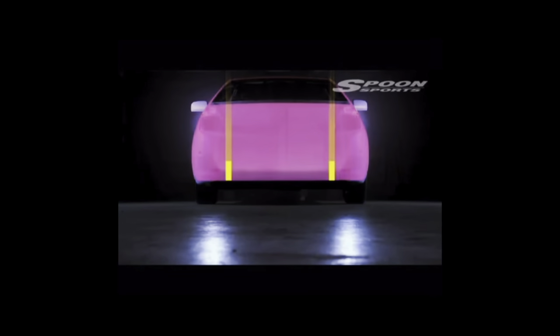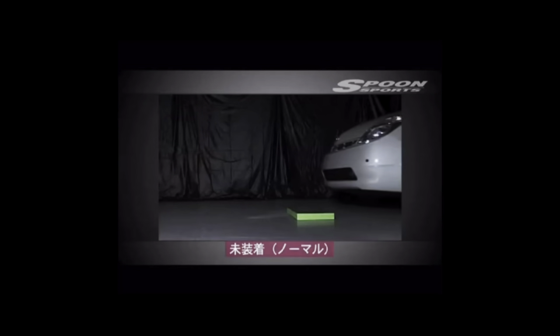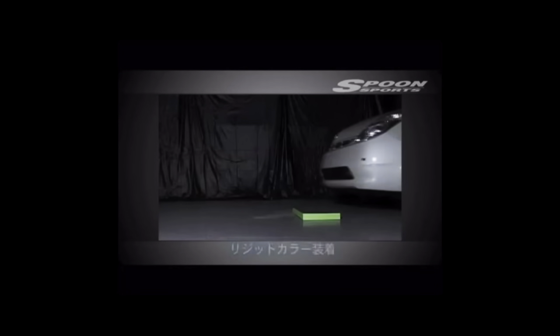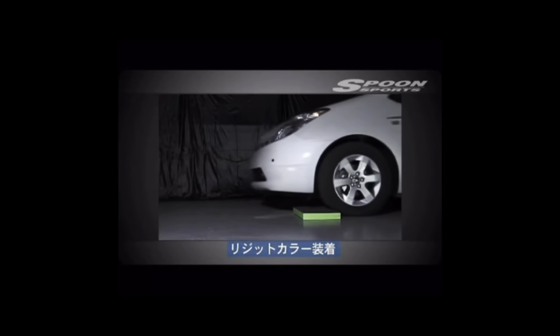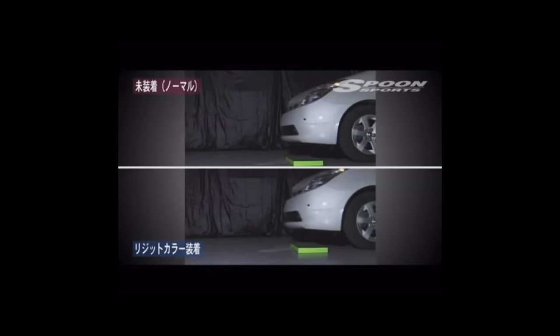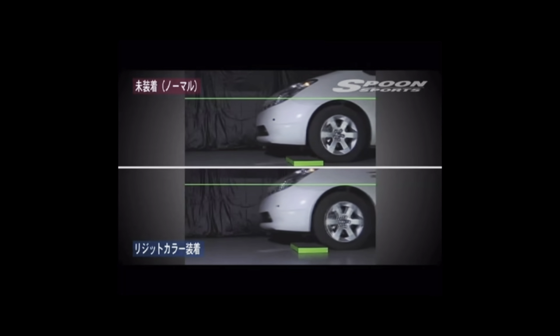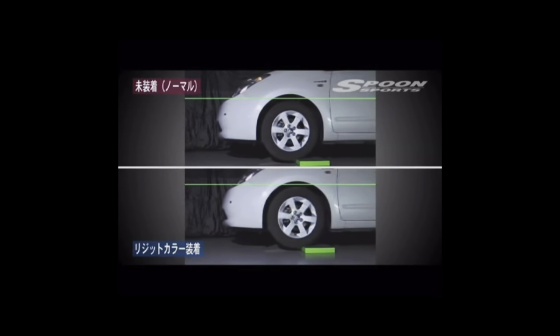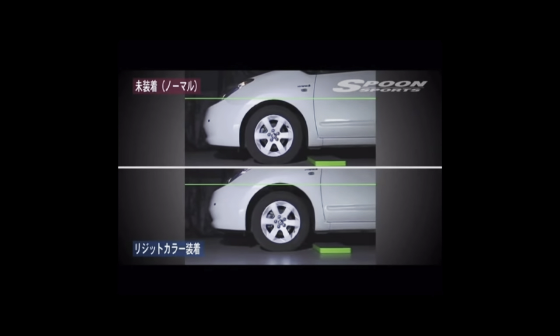This is almost as strong as welding the components together, as you would in a competition car. The rigid collars act as body reinforcement, and once fitted to the key points where the subframe meets the chassis, the join between them will be perfect, significantly improving handling. As the car comes over the step without the rigid collar, notice the vertical movement in the body. Now look at the same car fitted with rigid collars — the vertical movement has been reduced dramatically. Looking at the two tests side by side, the standard car is at the top and the car with rigid collars at the bottom. The rigid collar has removed any spring effect caused by the inaccurate join between the cross member and chassis, and the suspension is far more stable, resulting in better all-round handling.